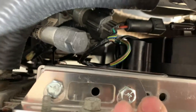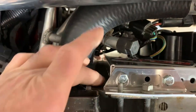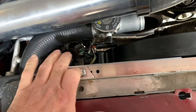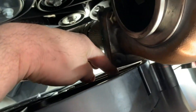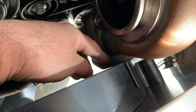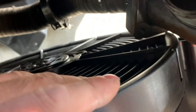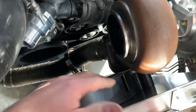It's really close down to the ABS module down there, but it still has good clearance. The fan shroud is moved over as far as it can go on the radiator to clear the ABS. If ABS wasn't there the fan shroud could be moved over more. The actual flange of the turbo is touching the fan shroud. This fan is really thick before it gets down to the blades — if it had one of those fans that gradually comes up to the motor it probably would have been okay.